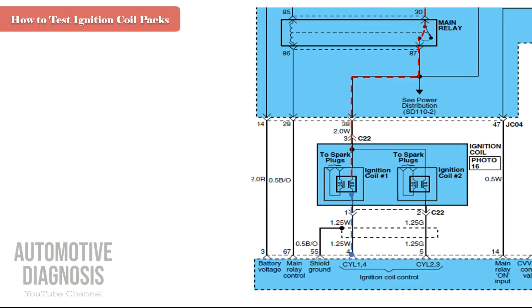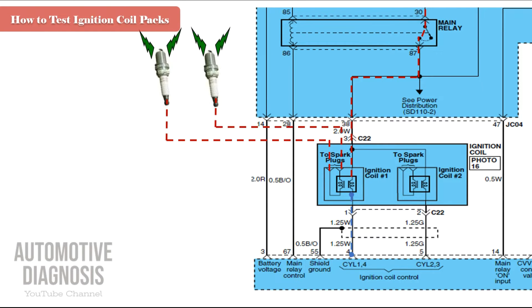At the exact time the spark is required, the ECU cuts the ground, so the magnetic field inside the ignition coil collapses and induces high voltage into the secondary winding. The secondary winding increases the voltage and provides it to the spark plugs. Two spark plugs fire at the same time. Only one is useful — for example, if cylinder number one is at end of compression that spark is useful, but cylinder four is at end of exhaust, so that spark gets wasted. Same story for ignition coil number two.